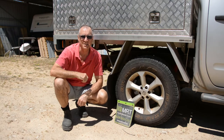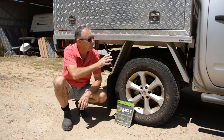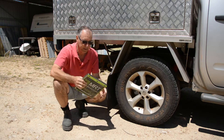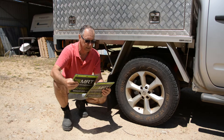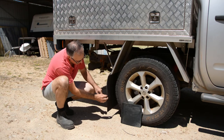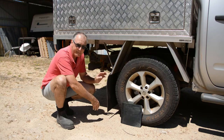G'day, it's Rusty from Rusty's Outback Adventures. In today's video I want to talk to you about mud flaps. When I bought the canopy and the tray for the conversion from the well body to the current setup, these are the mud flaps that came with it. As you can see, they're quite short in relation to touching the ground, so I've gone and made some heavy 3.8mm rubber mud flaps and extended them 150mm off the ground.